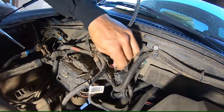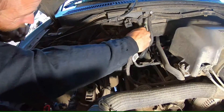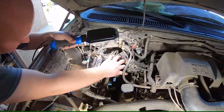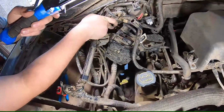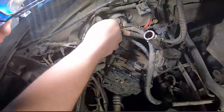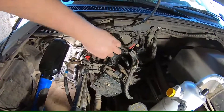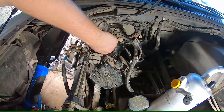My recommendation: keep these bolts and put them back in the hole after you remove the assembly. Way back here you have your accumulator — we just took this bracket off to get to it. Right here you're going to have your little switch. That's going to come out — just a typical pushpin plastic. Once you get your harness off, sometimes that can be a pain, especially if it's all dry rotted in. Tuck that out of the way and get your fitting off.